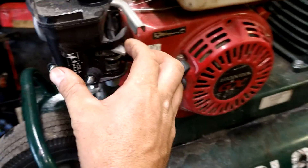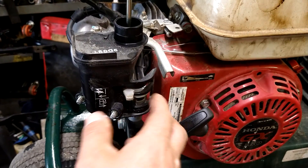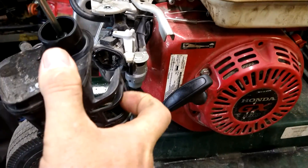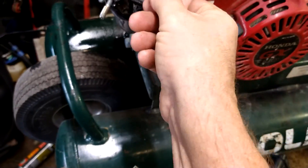We're going to turn this choke and the fuel on/off both this way. With them like this you're able to pull this straight off. With them in it'll stop you from pulling it off, so pull them out. Choke arm off.